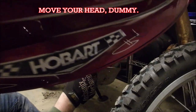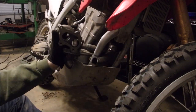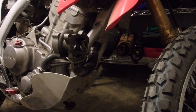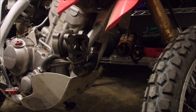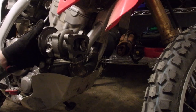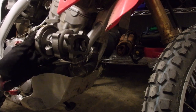That's where I've got it. When I tip the bike up it looks about right — I've got some marks across there, so I'm going to go ahead and take this off and weld this to that, put it on there, slap the turbo bits in there and see how it looks. There it is hanging on there. All the pipe sections from this piece up are welded; from here this way it's all just tacked in case I need to change it. I'll go ahead and drop the center section in here and put the compressor side housing on just to kind of see where I'm at — that's looking good.